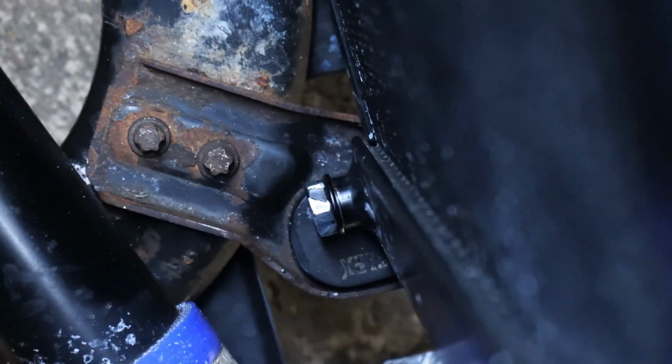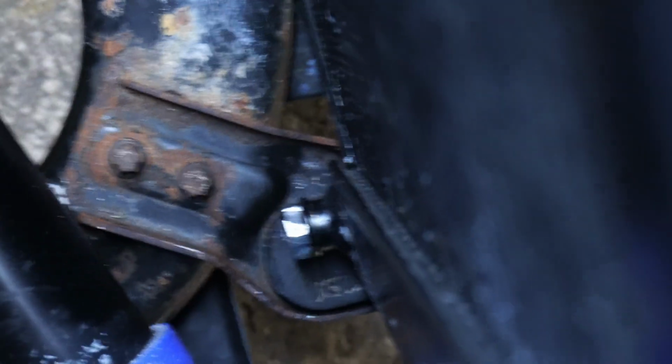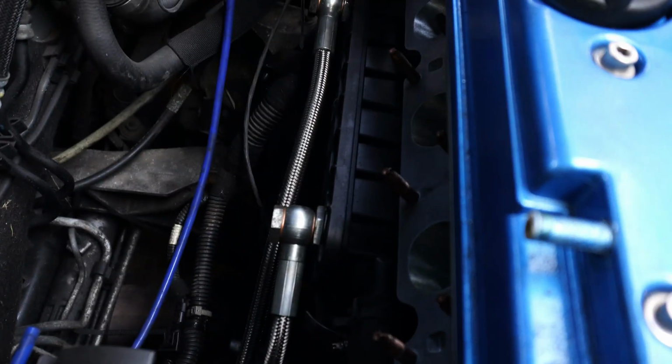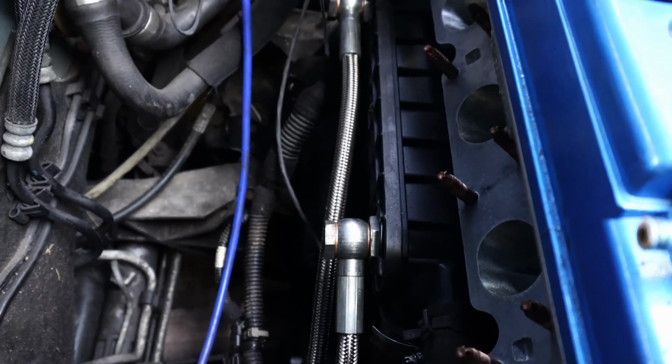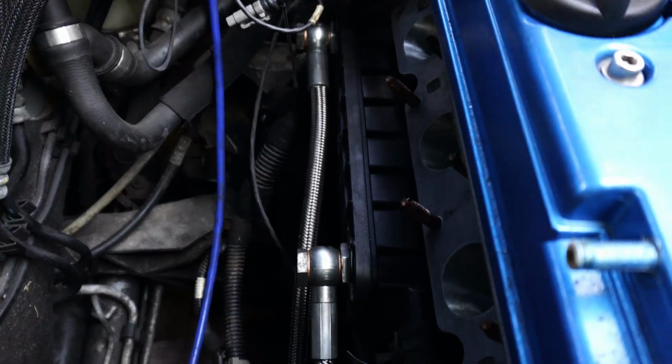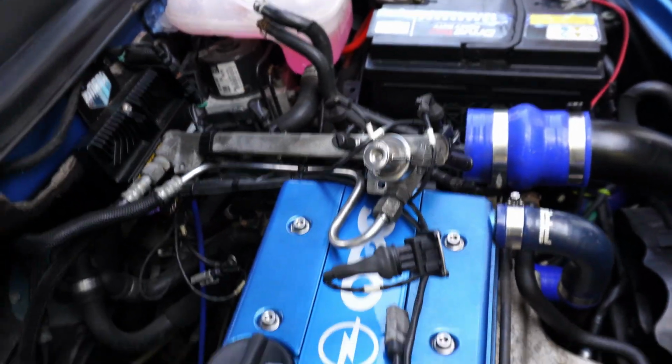They're coming tomorrow. I should have really just ordered them yesterday because they'd be here by now with the 1 PM delivery. But yeah, before I can get the oil cooler off and drain the coolant and stuff, I would like to have a fresh washer for the radiator bung, because it was dripping a little bit, I think, and there's a chunk out of it, and putting it back on is just asking to lose my coolant. So I will cover up the inlet valves for the night, put the injectors where they're not going to get crushed when I shut the bonnet, and leave it like that for today, and come back tomorrow morning with a fresh set of eyes, take the oil cooler off, fit the TIGWorks bypass, and put it back together.